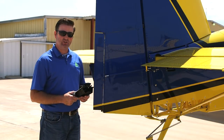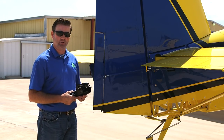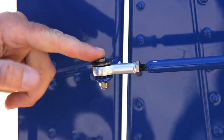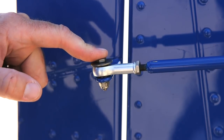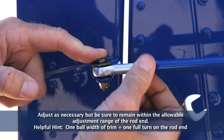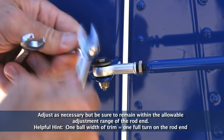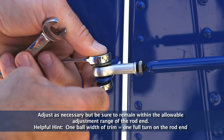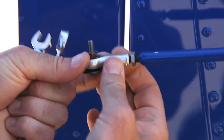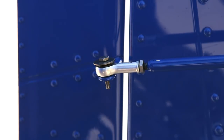Based on my in-flight evaluation of trim, this airplane needs about two turns of rudder trim rod adjustment. I'm going to make that adjustment using this rod end by shortening the rod two complete turns. First, I'll loosen the jam nut. Second, I'll remove the bolt. And I'm going to shorten the rod two full turns — one, two — and then reassemble.